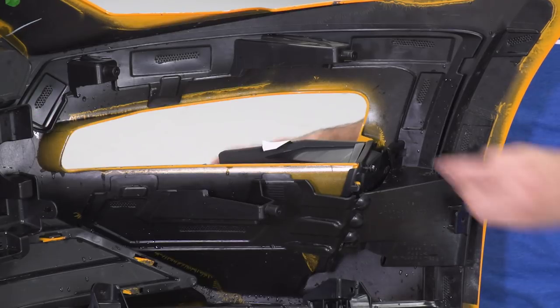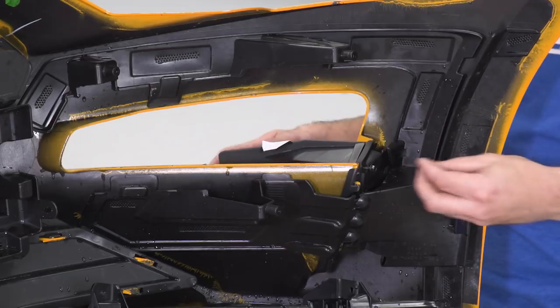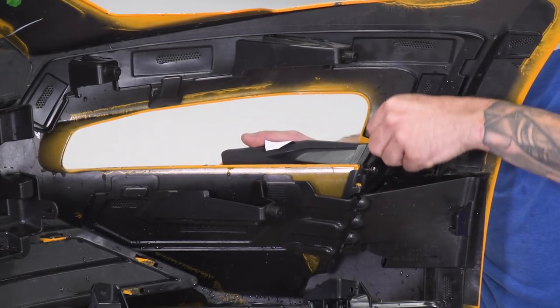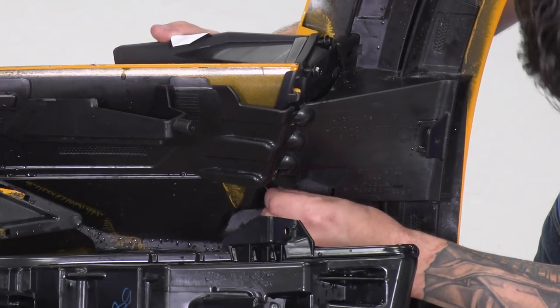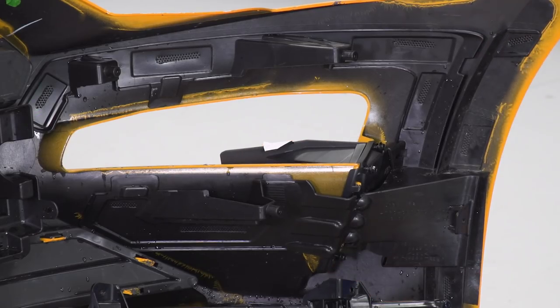You wanna make sure that you're putting this vane in place before you put your accent light back onto the bumper. I'll show you why in just a second. This'll go straight through the inside. And then again, from the bottom. Grab your 7mm socket and tighten those down.